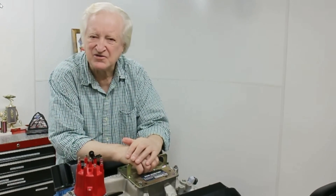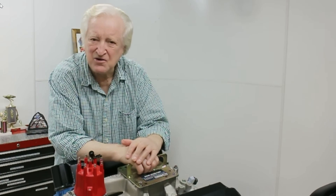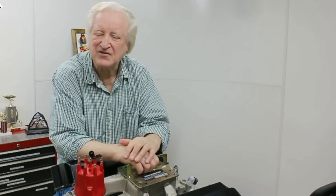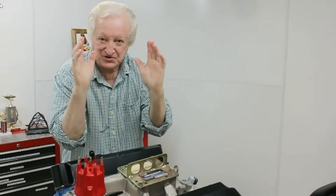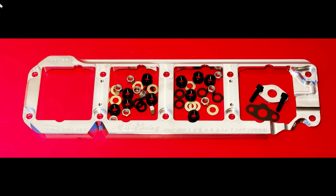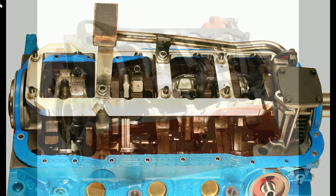Let's take a look at this aluminum girdle. It looks like it wouldn't save anything, but in fact it acts as a vibration damper and prevents those caps from flexing and fatiguing. Believe it or not, what you see here is good for a strength increase equal to about 200 horsepower. Here's one of the DSS stud girdles fitted to the block — it doesn't look like much, but it proves extremely effective.